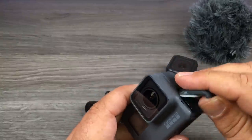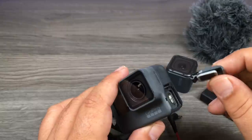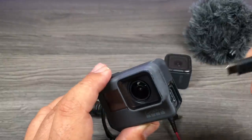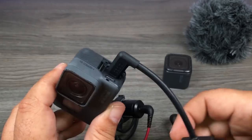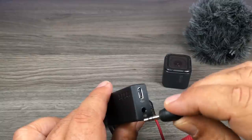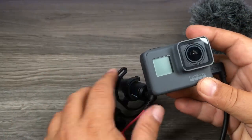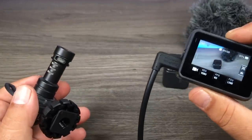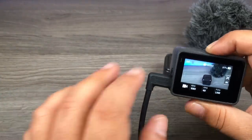I'm going to remove the side door, which opens up and exposes our ports. Ideally you want to remove the door — you can leave it on, but removing it allows you to mount the camera in a frame and still have access to the microphone port. We're just going to plug the adapter into the USB-C port on the Hero 5, then plug in the cable. It is all connected. We can power on the GoPro like normal and just like that it will work. You don't have to change any settings — when you have this adapter plugged in it's going to detect right away that there's an external microphone and it will disable the onboard microphones.